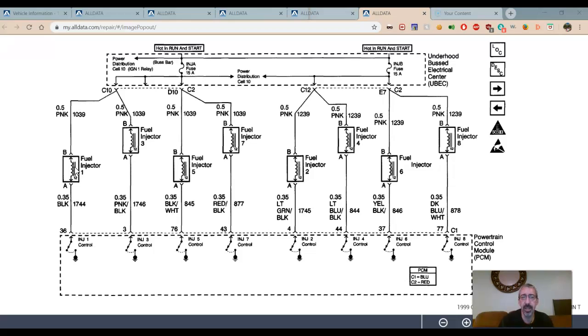If the cylinder goes dead, the fuel injector was working. If the cylinder stays the same and doesn't make a change, then there's something wrong with that cylinder. It's not the injector. Well, it could be the injector. Let me rephrase that. Okay? So yes, the injector didn't make a difference. It doesn't say anything about fuel. Right? So remember when we were doing the test where we pulsed the fuel injector and watched the fuel pressure drop? That would be the next thing.